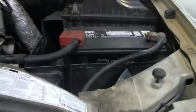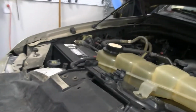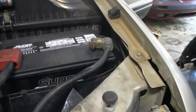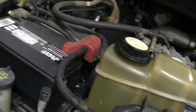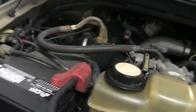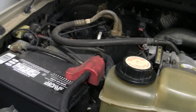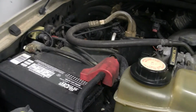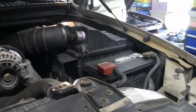And you do want to be sure that you come to the front side of the truck. I've got dual batteries in this 250, so you want to pull off the negative. And you can pull off the positive too, but you've disconnected it. Either way, as long as you break the circuit so your battery is no longer in the circuit. So I want to pull those off, and you can also verify you've done it right.